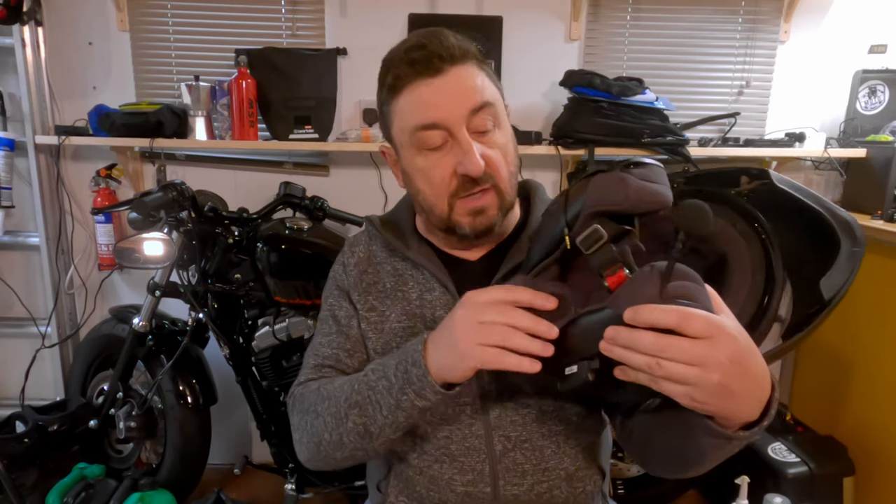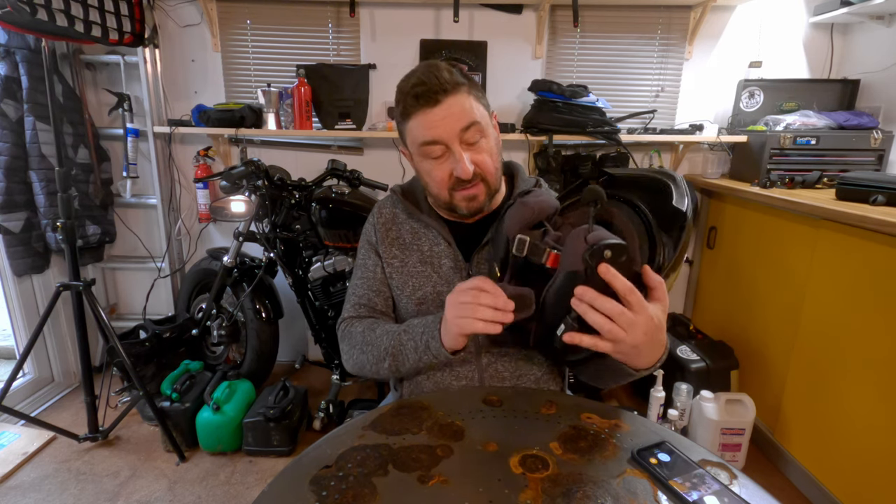Think about it — you have this tiny little speaker with very little output. And if that is located just half an inch away from the center of your ear, there's nothing left. So what you have to do is bite the bullet, take a little bit of Velcro and move the speaker around. You also have to take into consideration how far the speaker is actually away from your ear. In my case, I had to completely disband the area inside the helmet where I was supposed to mount it and put it on top of all the padding in a nice spot. Now the speaker is very close to my ear and I have maximum volume.